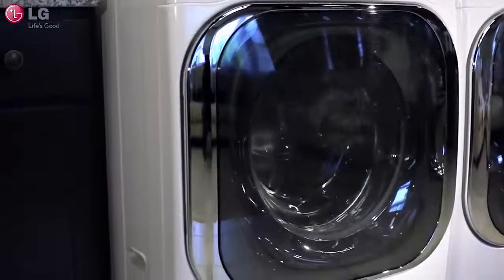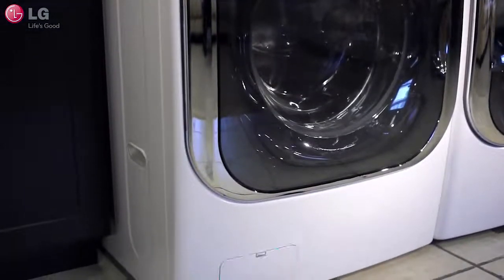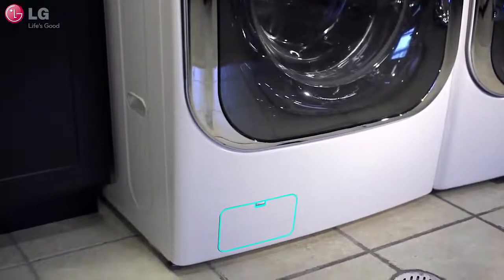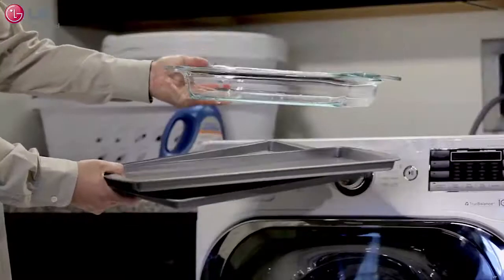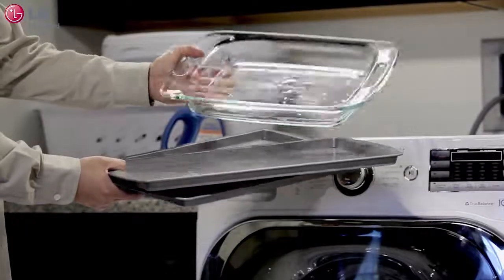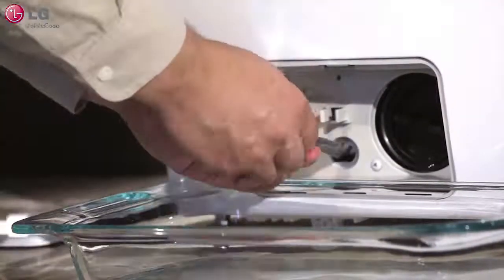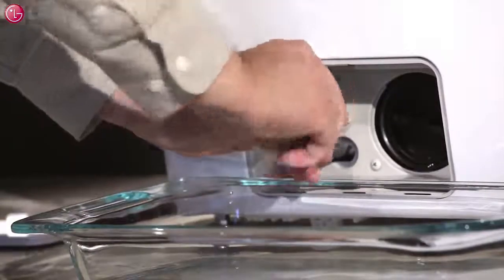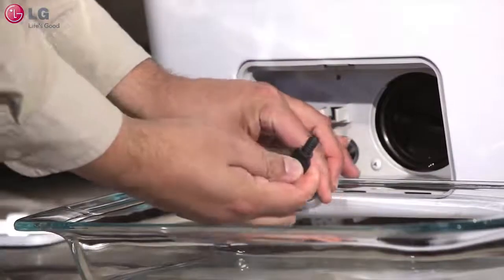If you are not able to run the drain-only cycle, another way is to manually drain the tub by unplugging the drain hose located behind the access panel on the lower front of your washing machine. Be sure to grab some shallow pans big enough to collect the water. It will be an excessive amount of water, so proceed with extreme caution. Once completely drained, plug the hose and reinsert it back into place. This will also allow the door to unlock.